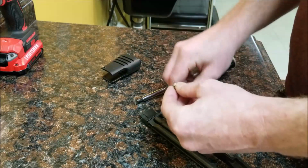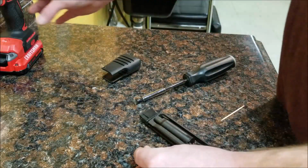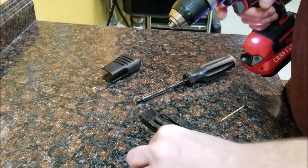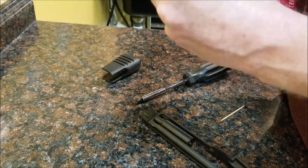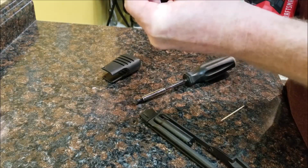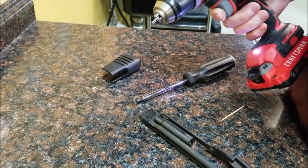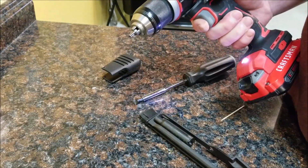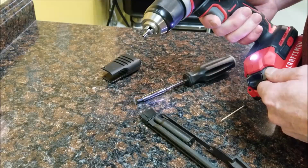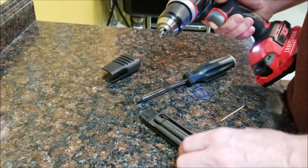Now when you've got it completely apart, what you can do is get a cordless drill or chuck it in a vise and put your valve in there. And you can use maybe some real fine emery cloth and go over that, and then a rubbing compound to get a mirror finish. That'll help preserve your front valve seal.